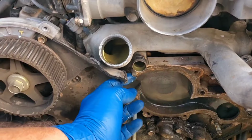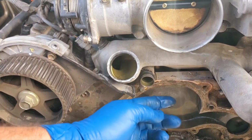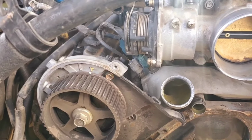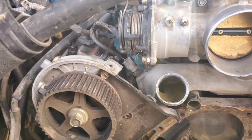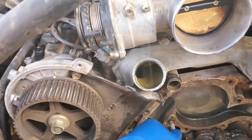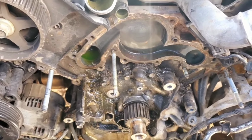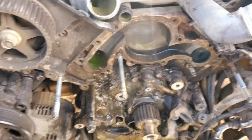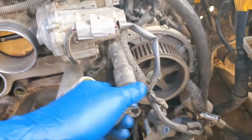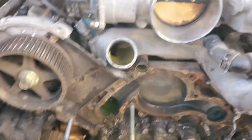But, yeah, this stud, I'm thinking if I can get two thin nuts on it and then get a hold of the back one, use the front one for a lock, I might be able to break that loose and get it to come out. Somewhere I have a little tool. It's a stud puller. You just put it on, it bites down, and you can pull them studs out, but I ain't exactly sure where that's at. But anyhow, I think it'll all be going back together once I get that cleaned off and get that stud out.